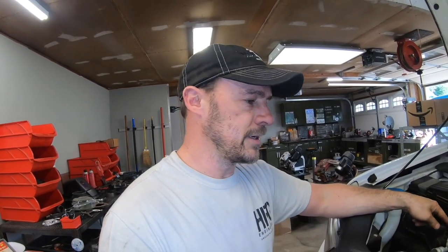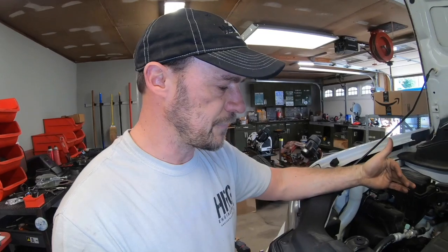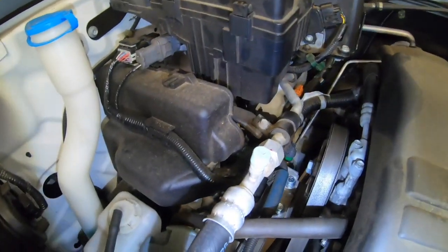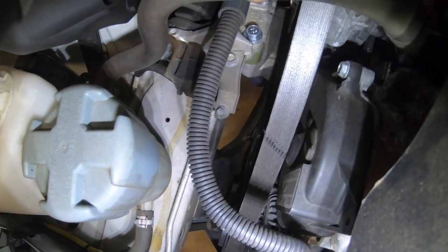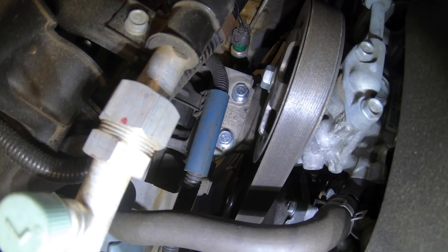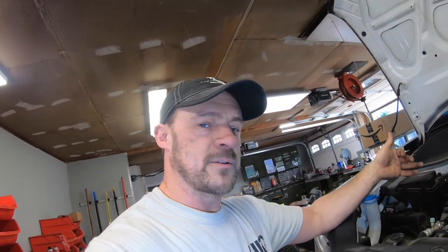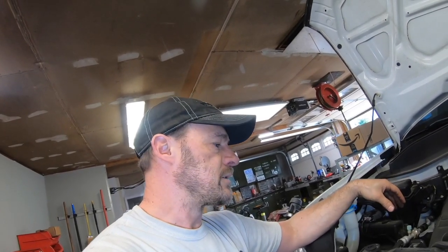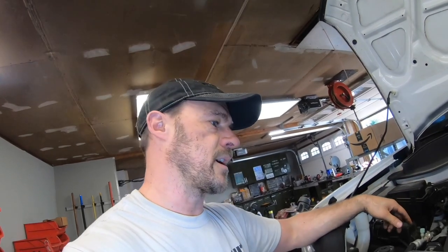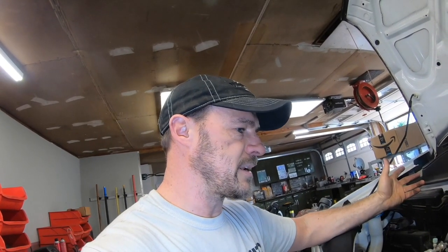The only thing under the hood is two spacers on the passenger-side engine bracket, with two longer bolts that come with the kit. You can see the two green spacers and new bolts if you look carefully. You can actually take those bolts out and put the spacers in without the engine even moving — there are enough mounts everywhere else that it doesn't fall. If you're nervous about it, just put a jack with a piece of plywood under the oil pan to support it and lower it gently.